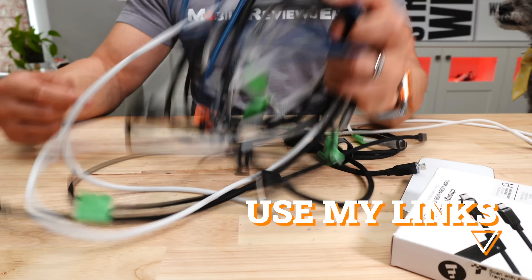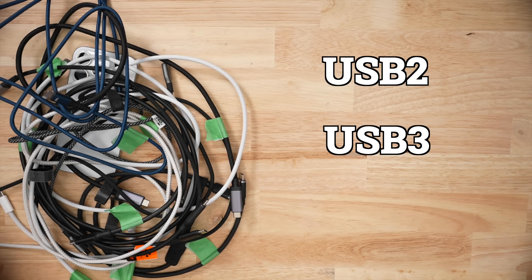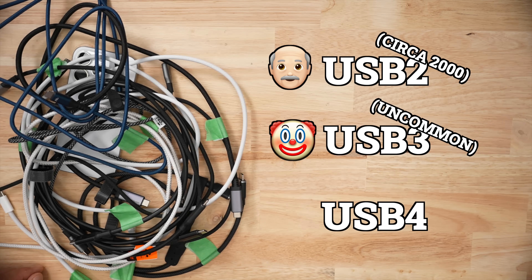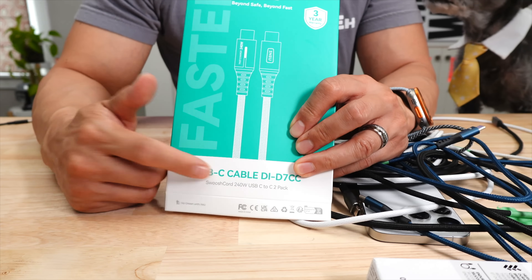If you're planning on getting a cable, use my links. No influencer is going to do all this testing, but that's just not me — I spend way too much time figuring stuff out. With USB-C, it's a literal dumpster fire. You've got USB 2, 3, and 4: USB 2 is really old, USB 3 is a protocol that barely gets used, and USB 4 has versions 1 and 2. Every version 2 USB 4 cable I tested failed horrendously. On the power side, you've got PD, PD 3.0, and PD 3.1 — 3.1 allows up to 240-watt charging, which sounds awesome but isn't very common. Not many devices charge at 240, but it's on every cable nowadays because bigger numbers sell.